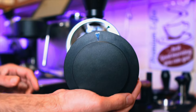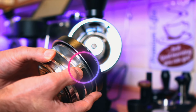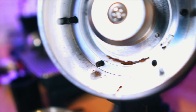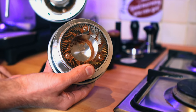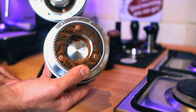First we need to open the cover — very simple, just rotate it. Then you have to remove the front burr. If you watched my unboxing video you know there is a flying pin, so just be very careful you don't want to lose it. This time it actually stayed in. Once the burrs are away it's easy to see inside the burr chamber. You can see the clamp looks different than with previous DF-83 models because there the burrs were horizontal — here they're vertical. The front burr is very easy to swap — use the proper screwdriver.